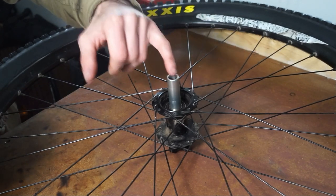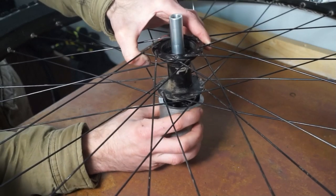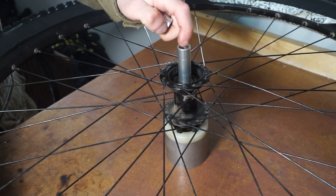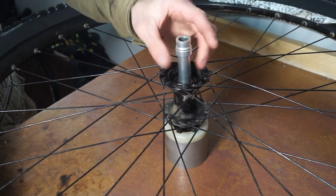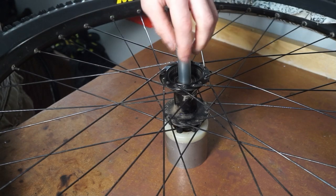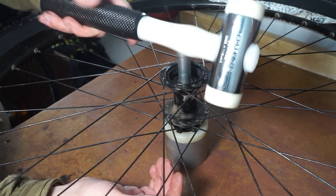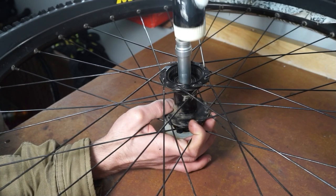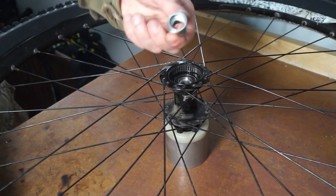On the Hope Pro 4 you have to hit from the freehub end and push out through the disc mount end. If you leave the hub flat and hit it, it's just going to hit the surface and not move — that's why you need to raise it. I'm using an old hub support tool, but you could drill a hole in a piece of wood the same diameter. I'm putting an end cap on the axle so if I miss with the hammer I'll damage the end cap rather than the axle — these are only about six to eight pounds to replace. I use a nylon hammer so the hammer gets dented rather than what you're working on.